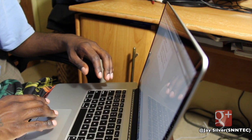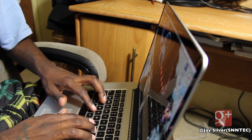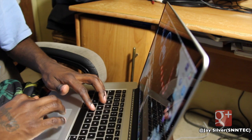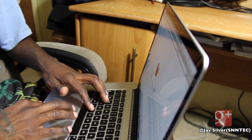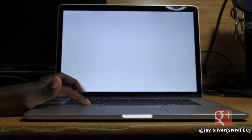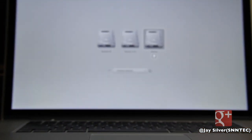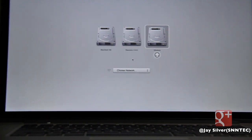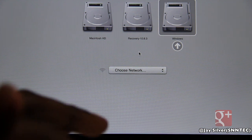The iMac comes, if you upgrade it for $150 more, to the 680MX, and according to GPUbenchmarks.net, on a benchmark they use, Passmark, the 650M scores about a 1274 in comparison to the 680MX. It scores a 4,394. That's a 3,120 point difference. And if you configure the iMac a certain way, it's cheaper than this model that I have here. So I would assume that Apple chose this particular video card for power saving reasons, to conserve the battery life.